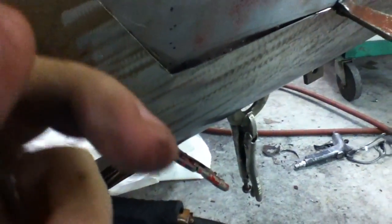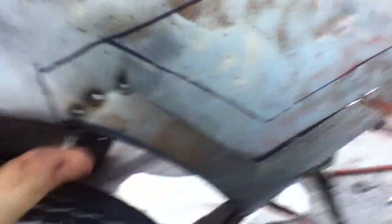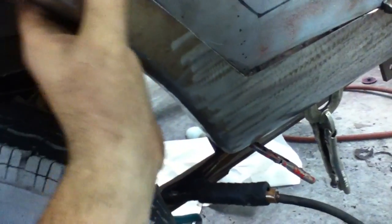It's in there, nice — not too far behind, not too far forward. The one thing that's going to get me is a little dent right here from before that makes it look like it's fallen behind, but it's actually pretty straight. When it comes to that dent, you're going to want to push from the inside and push back and forth all the way down. Remember you've got to do this side first because of the way it dips in right here. You can't just work here and hope it spreads throughout — it'll just bunch up in the middle. Follow a line down, and if you need to wait for it to cool down, do the palm test.